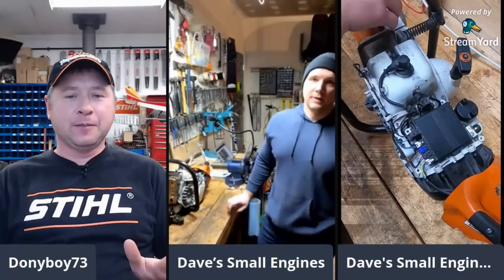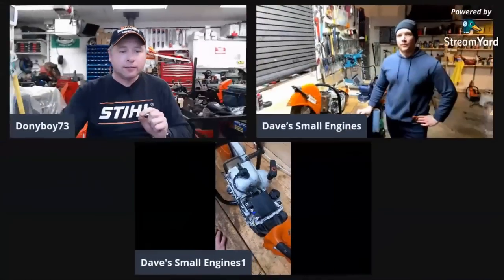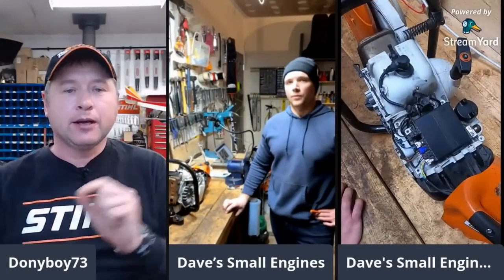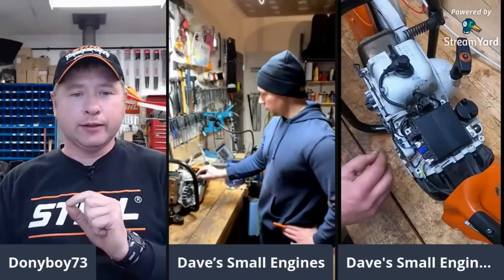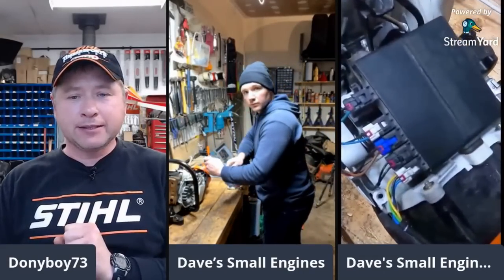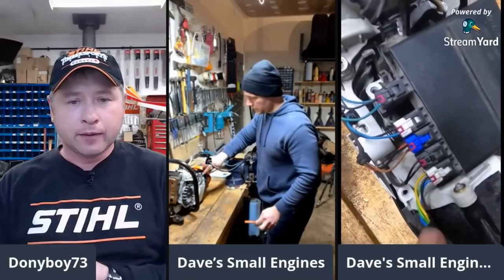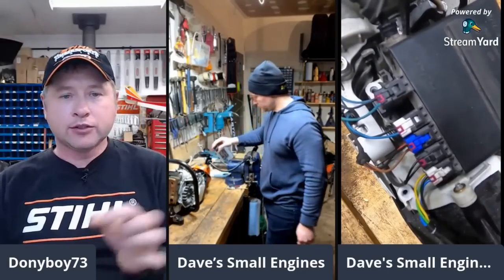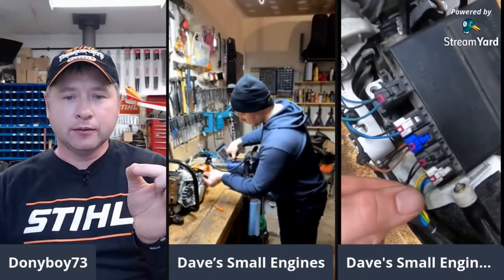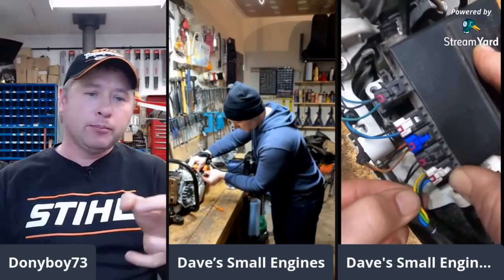I'm going to reveal right now how I've been able to fix a few of those with the same problem without the diagnostic stuff. Okay, what's that? Those little plugs on the module — what you want to do is go beside each plug. And you can bring your GoPro down. You know, where you see the yellow wire — yellow, blue — the first plug toward the trigger handle. What I want you to do is just gently grab each wire on its own with your finger and just wiggle it in a pulling motion, but don't pull too hard.